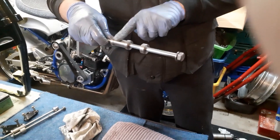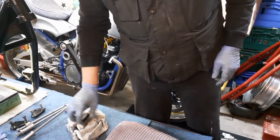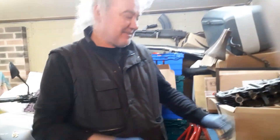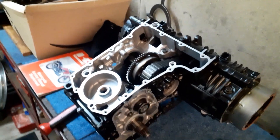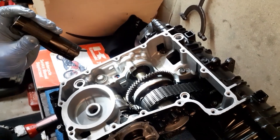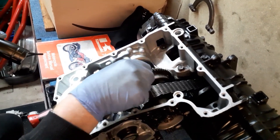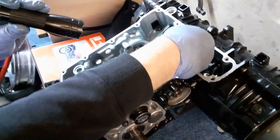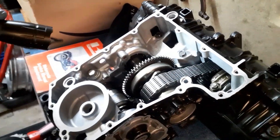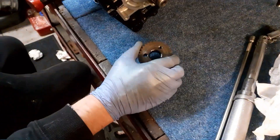Since I last saw you I've been to Jeff's and he's machined all these stainless spacers I needed — measured to my dimensions. So when the engine goes back in it can be fully tightened up for the second and last time. You've also found a problem with the clutch — the clutch basket has the usual Z650/Z750 backlash. Inside they have rubber bushes which wear and shrink, causing backlash, so when these are running they sound like a bag of spanners if you don't address them.